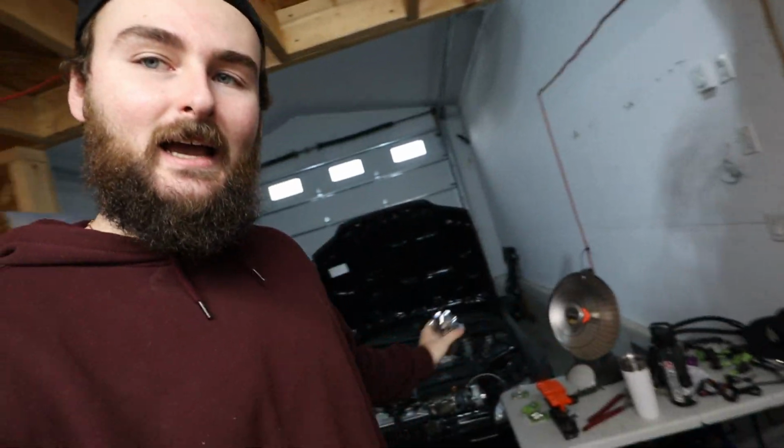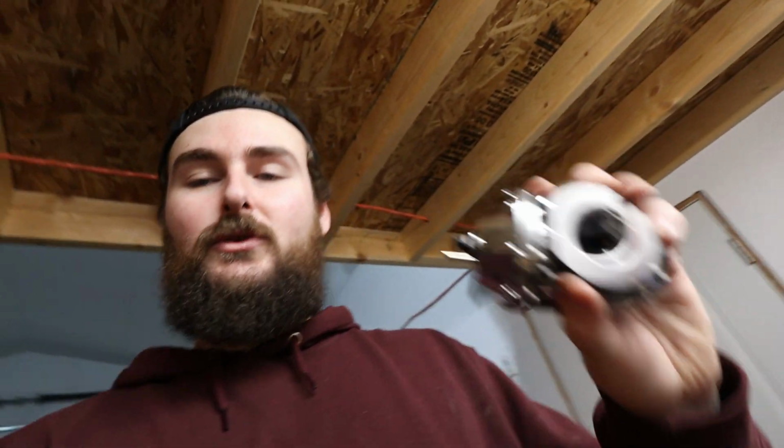So this is the 3rd week of Vlogmas. We only have 1 more week of Vlogmas, so hopefully it is the Christmas season. People are busy and booked up, but hopefully I can make a video of taking the charge pipe off, taking it over there. He can cut one out, he can weld one in place, and then we can have a proper block off. But for right now, just so the engine bay is situated, clean, tidy, and I can start this car up and move it if need be, I'm gonna go ahead and put the HKS blow-off valve back on. And I do think that this is gonna be a perfect template. So I'm gonna bring this over to him, but let's go ahead, let's get this situated, and then I want to talk about that turbo guard, see what we can do about that.